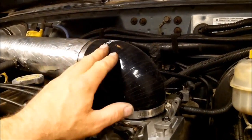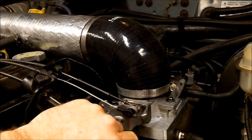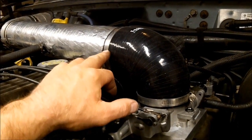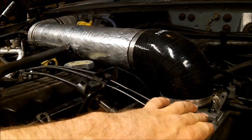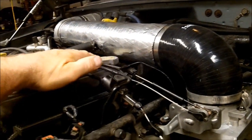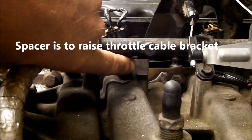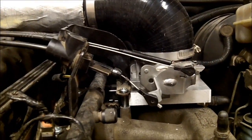I've got a turbo quality 90-degree elbow. It has a 3.25-inch inside diameter, with a 3.5-inch inside diameter on this side. I had to cut off quite a bit of the length, because I've got to keep this slammed down on top of the valve cover to have hood clearance. I have to add a three-quarter inch spacer — there's a couple of them, one here and one back here. We're ready to fire this thing up.